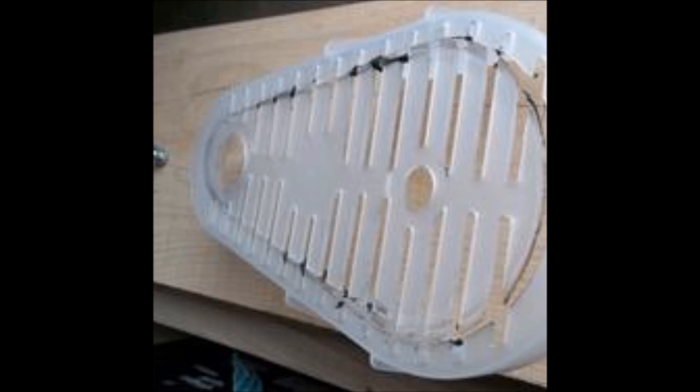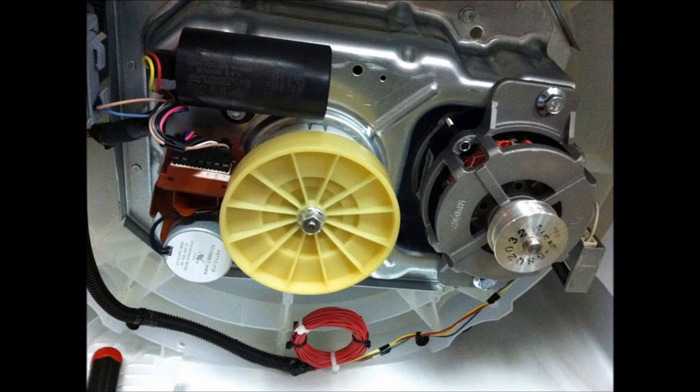What happened on this washer — I just worked on it today — the belt guard that goes on the bottom had a groove cut into it from the belt rubbing on it. That was caused by this yellow pulley in the center, which is the drive mechanism for the transmission. The nut that holds that in place was loose and had come loose a little bit, allowing it to wobble. That wobbling pulley allowed the belt to work its way down, make contact, and make noise until it finally cut through the belt guard. This is a 13mm nut.